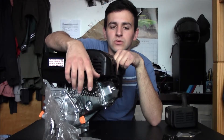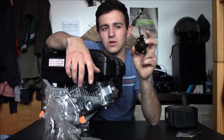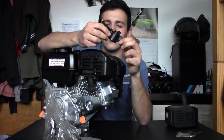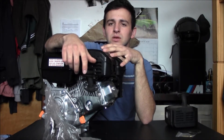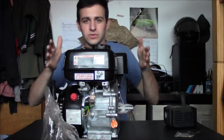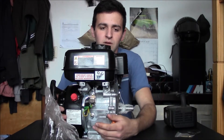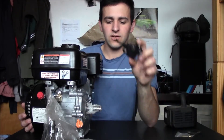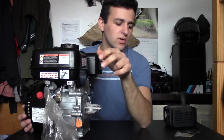Changing your spark plug to a better one will make the engine work better as well. Another modification is removing your oil sensor, especially in a go-kart where you'll be cornering hard. The oil sensor detects whether oil is rising or lowering, and if you tip the engine, oil goes to one side and it thinks there's no oil, so it automatically shuts off. I show how to take that out in my other video, along with removing the governor, rod, and flywheel.